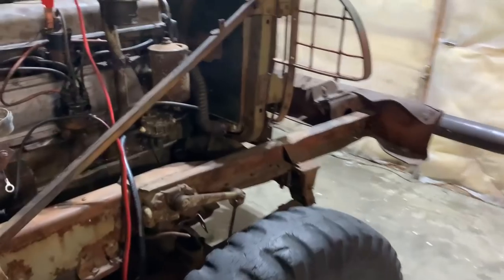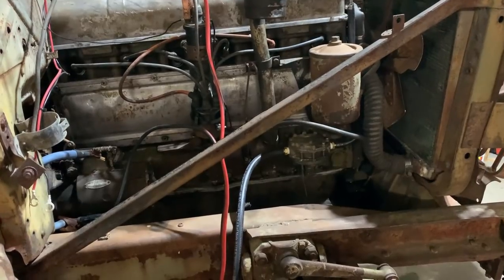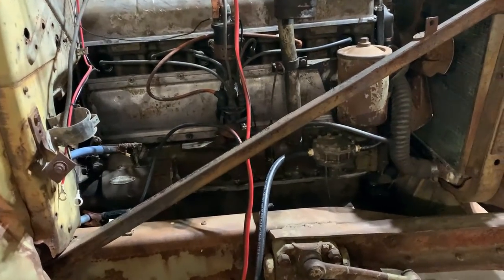And then I played around with seeing if it will go into gear, and couldn't get it to go into gear. Just wants to grind. Of course, I thought it might be the RPMs. I can't bring the RPMs down enough to get it in gear, even with the clutch in. So I shut it off, put it in first gear, and then held the clutch all the way down and hit the starter, and it creeped ahead. So that tells me that we don't have a clutch yet. Might have to play with the adjustment on that, or see what else is up.